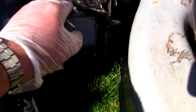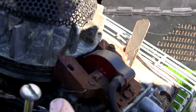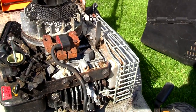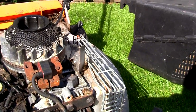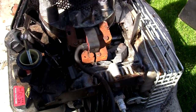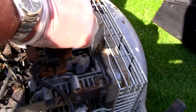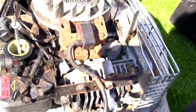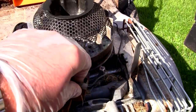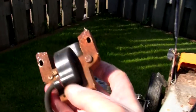For anyone who's new to repairing these for profit — see the side of this ignition coil where it touches this flywheel? It's flat on the good one, but this one's all splayed out. I'm just going to undo that one and swap it over. I can't really understand how it's got to that point, to be honest. It's really easy to change these over — all you've got to do is get a quarter-inch socket and unscrew the whole thing. Just unhook that electrical connector from underneath and take that one away.